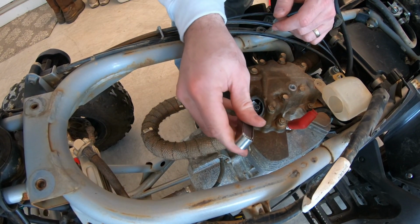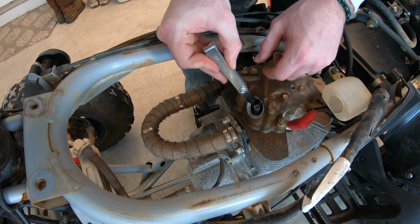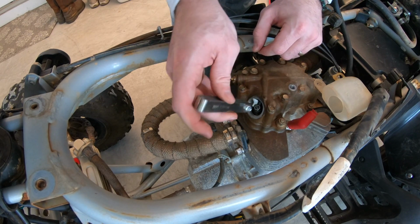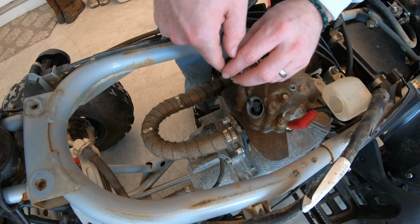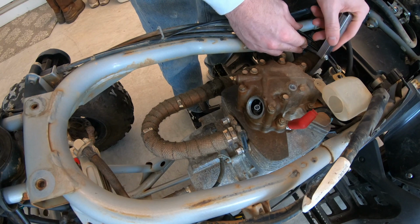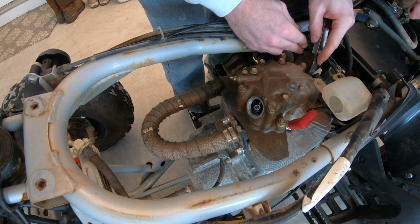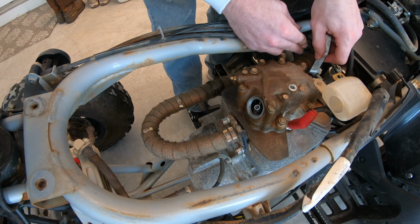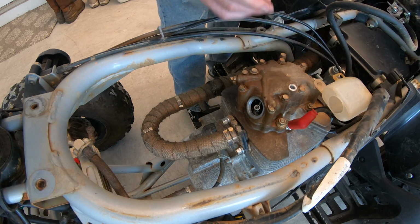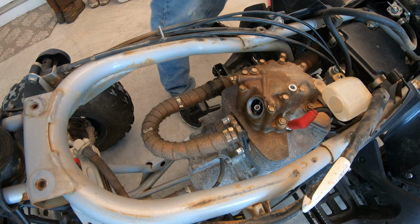I might have to do a little bit more bending, but it seemed to get in here. And that is really tight. I can't even see if I can get it under the back side. Yeah, so both of my valves are extremely tight. I can't even get the feeler gauge in them. So I'm gonna loosen them up even more and see if I can get this underneath it and then adjust.